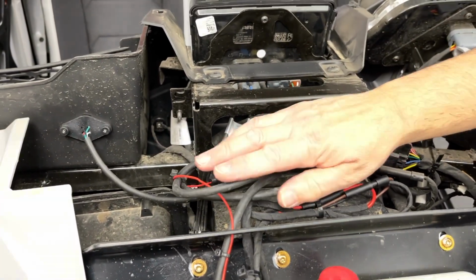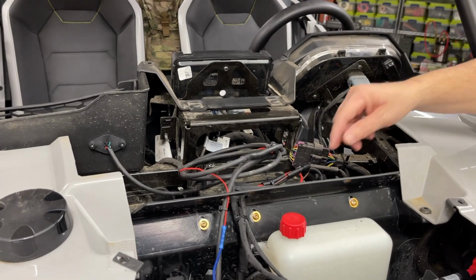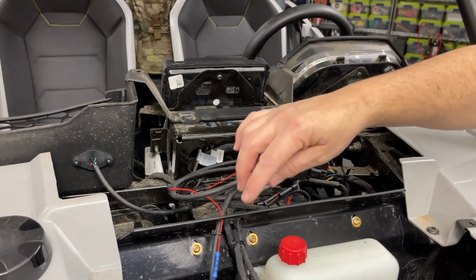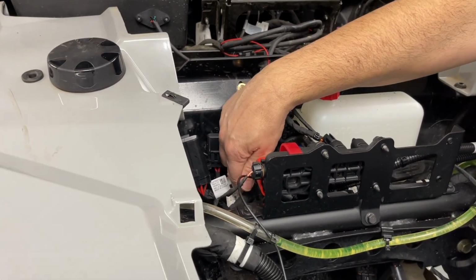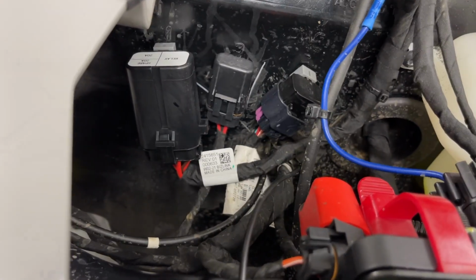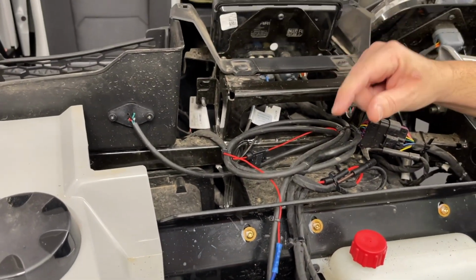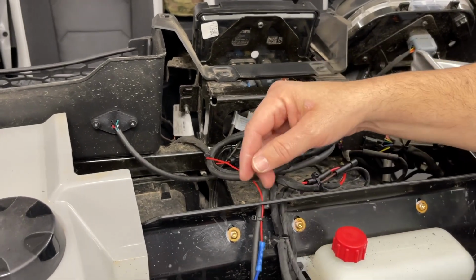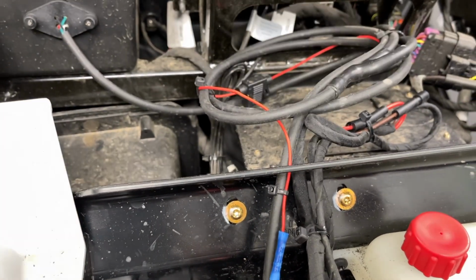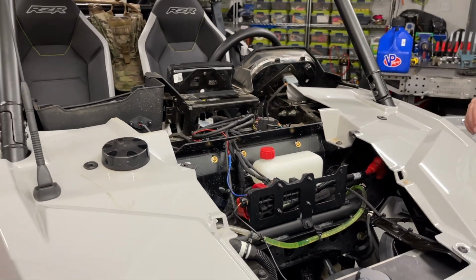And you can see where we put some of our wires, where they're hidden. If you remember, we put in our winch, and then we just put in a light bar as well. So we can hide all that here. Now, some of you said, why didn't you run it down in this bottom grommet way down there, like we did on Nathan's? Well, that's a lot of wires through here. And also the relays, the switch itself, and the connector on the light bar would not fit through that. So keep it as high as we can. Maybe one day we'll come up with some kind of grommet for that. It is rectangular. Maybe you know of a rectangular grommet. Let us know. So now let's get into the wiring.